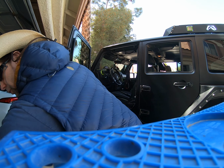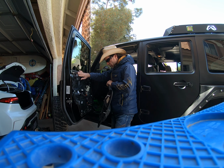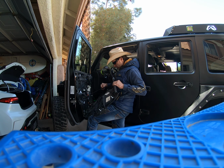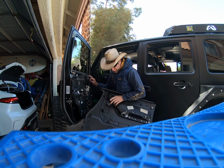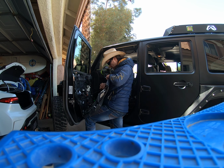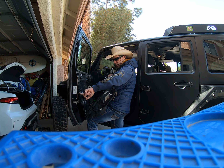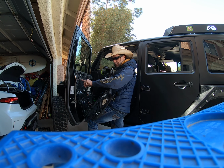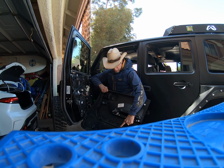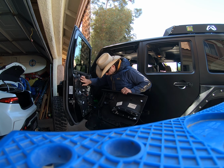And here is the door panel, right here. First thing we're gonna do is connect this wire right here. It goes right in, right here. This is for the electric locks, so we're going to pop that in. And you can also see that all of these right here, here, here, that's where these little Christmas tree plugs go in, and that's what holds the panel on.